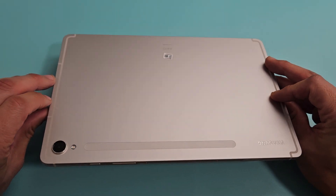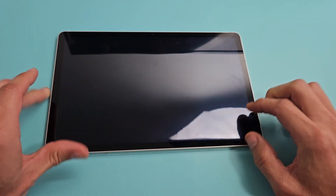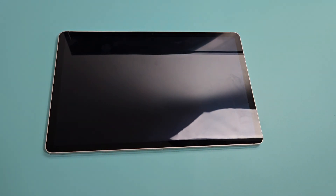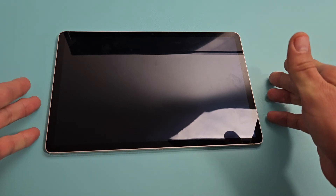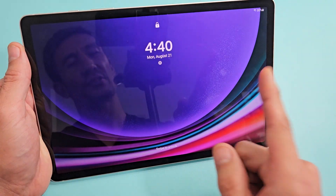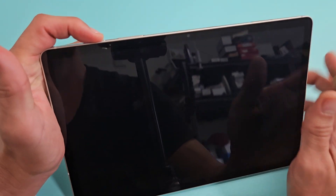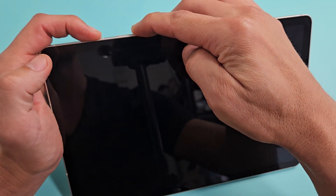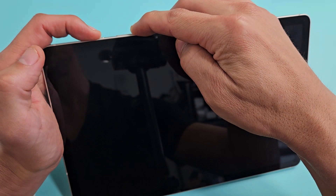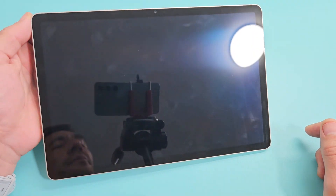This last option is what I call the freezer method. Grab your tablet with no case on it, go to your freezer, put it in there for 15 to 20 minutes. After that, take out your cold tablet and tap the power button to see if the screen comes on. If still stuck in a boot loop, do the same force restart: power button and volume down, hold for about 40 seconds until the Samsung logo appears, then let go and let it boot normally.